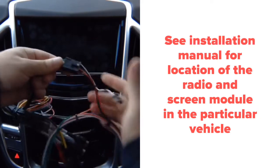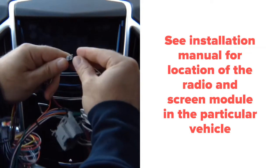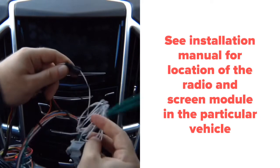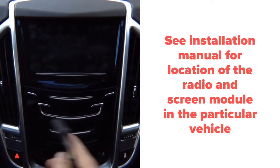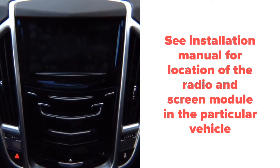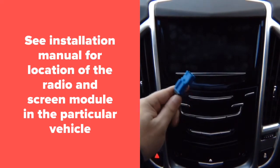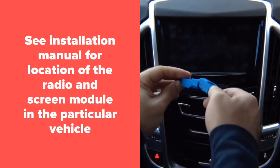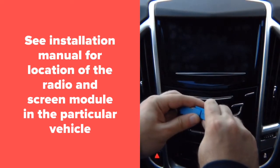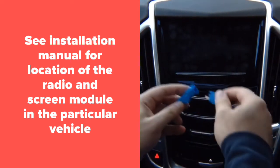If you install Apple CarPlay or Android Auto, since you already installed this harness, it joins together to the secondary harness, then you plug this into the module. You'll find another module located next to the first one behind the glove box with a blue connector. Unplug it, plug the factory connector into the supplied connector.